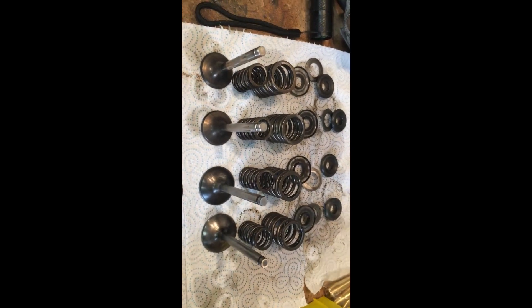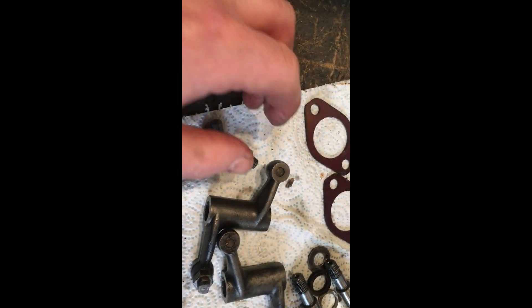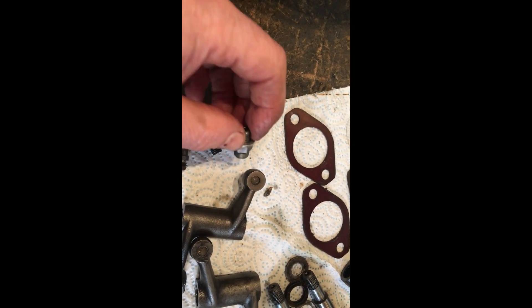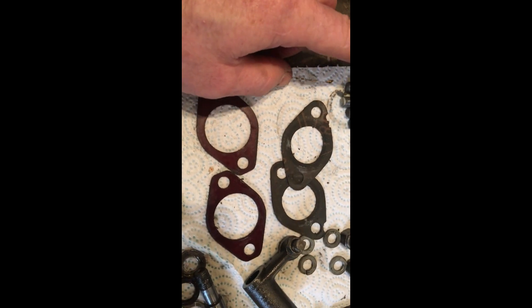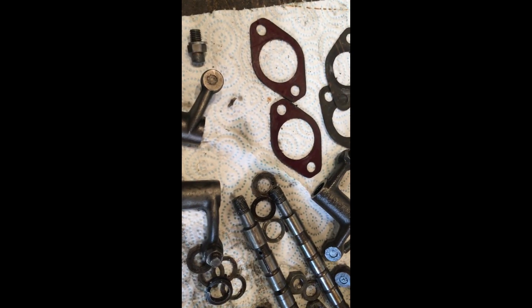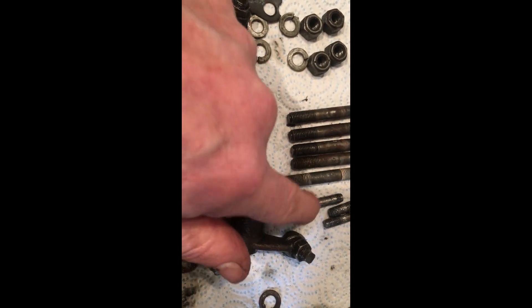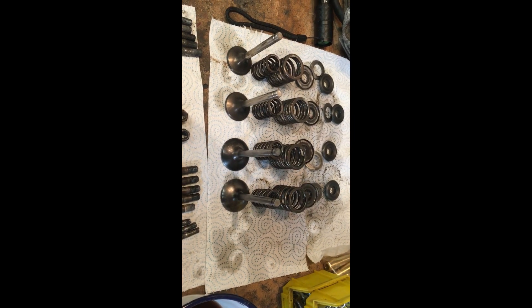The next thing we'll do is individually grind these in and then install them, so that we ensure the valve we've ground into a particular seat is where it'll reside. I've also cleaned up all the bits and pieces ready for installation - we've got the nibs here for the intake balance pipe, and also the union for the rocker box oil feed. These are the good parts from the stash taken from the two cylinder heads. We've got more carb mounting studs and rocker box studs than we need, so we'll select the best ones. A few items are totally mashed up and will be thrown away. I'll do a time-lapse of grinding one of the valves and installing it, then we'll get the rest of the head done.